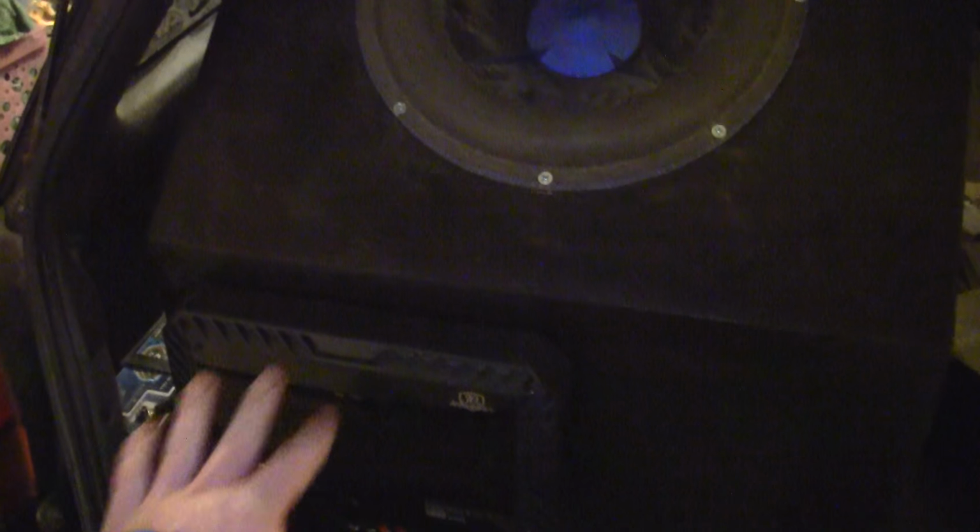This is the Mofo 15. And we have the Banff 4000D. And I wasn't a big fan of mounting either of the amps right on the box because the vibrations can kill the amp. It's not good for them. I did put rubber washers behind the amp to help lessen the vibrations on them, but there wasn't anywhere really to put them. I thought about the backs of the seats, but there's just not a lot of room, and he wanted to keep this aisle here open so that if he had something big he can still get it in there.